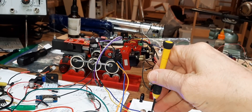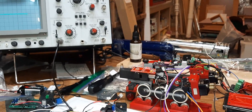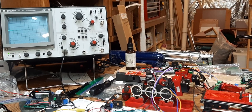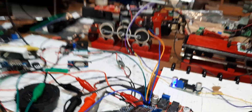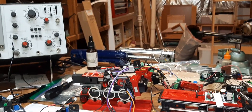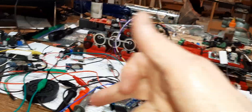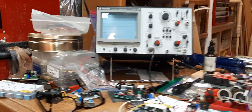I did crank the smoke down a little bit so maybe I went a little too low — another beauty of this thing is you crank it up a quarter turn and you can see more smoke coming in already. I've got a leak over here which will make the smoke more plentiful, and when you slow down you get your puff. The wiring is a little loose too — some of these connectors are iffy. But look how flat that signal is now; it was zigzagging two boxes up and two boxes down before, and now it's pretty doggone flat.